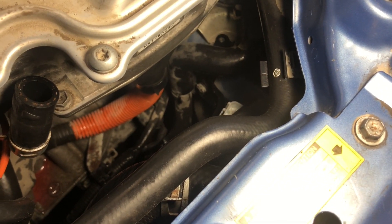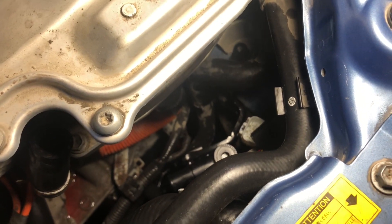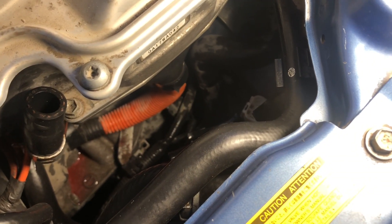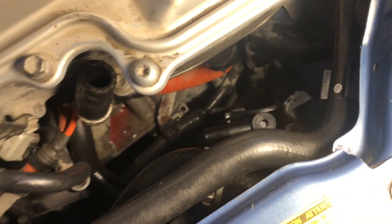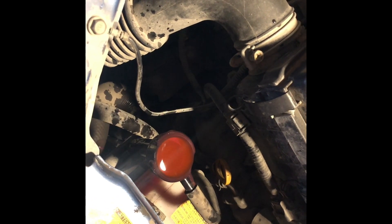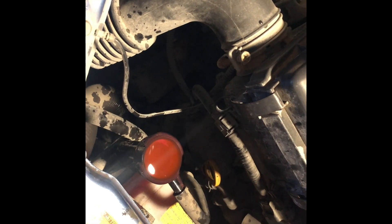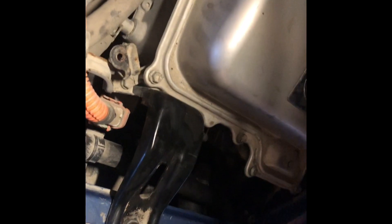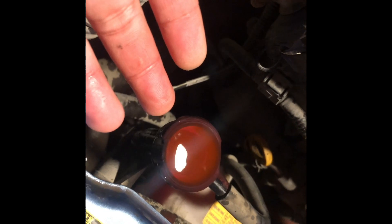I got the 10mm bolt in. The reason there's no other bolt is because it's broken, but one bolt is okay — I tried moving the bracket and it's sturdy. I'm going to put in the connector, then the lower and upper hose, and the one going to the heater storage tank. The bleeding procedure is simple: fill the engine line and bleed until there are no more bubbles. Everything is filled up and the bubbles clear out — it's a pretty basic bleeding procedure.